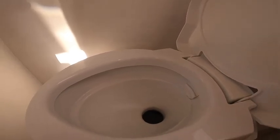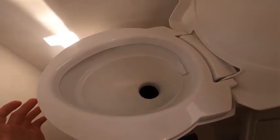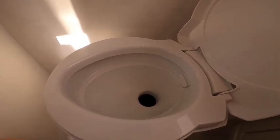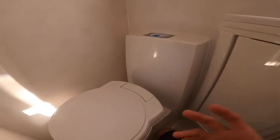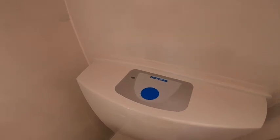Always flush the toilet first and put a small amount of water in before use — this helps keep the seal between the toilet and the cassette lubricated and not hard. Then open the blade using the grey lever — slide it to the right and you can now use the toilet. After use, give it a good flush. If you've bought the blue and pink liquids together in the twin pack, get an empty spray bottle, dilute a little pink with water, spray the bowl — it gives a fragrant smell and cleans the bowl. Once flushed, close the blade back to the left. If it were to stay open the cassette won't come out the outside of the van, as the mechanism is engaged. Once closed you'll be able to slide it out — get in the habit of doing it in that order. The cassette will indicate on the panel when it's full and time to empty and replenish with chemical.